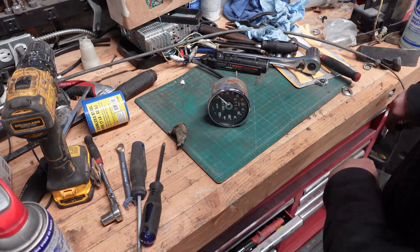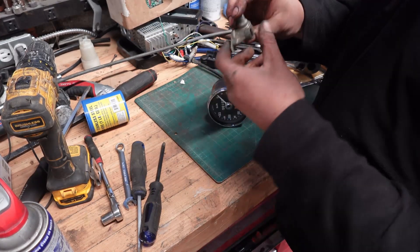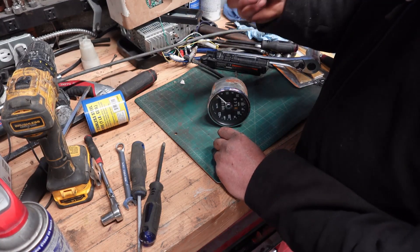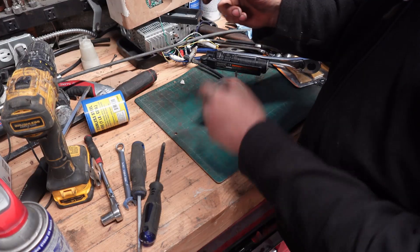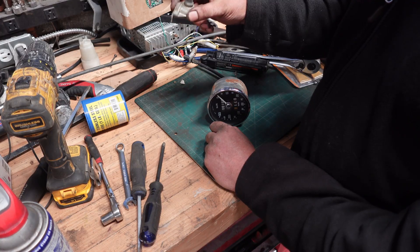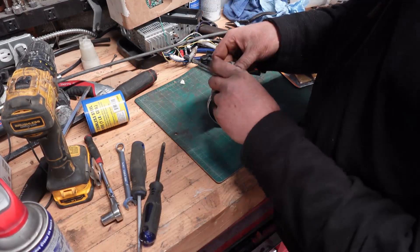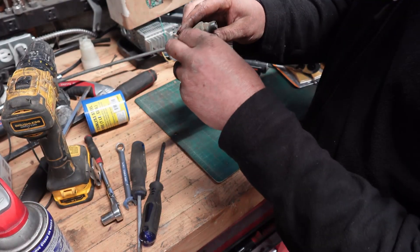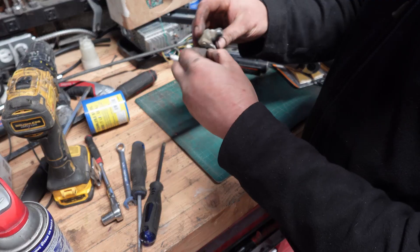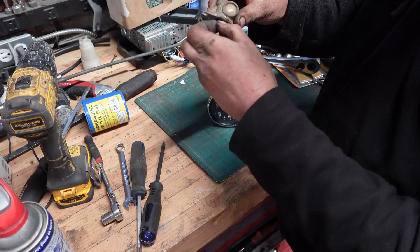So I'm now very suspicious of the angle drive on the gearbox. What probably happened is this gauge-side angle drive got gummed up. I was going at a high rate of speed — this broke when I was going at least 70, maybe 80 — and that angle drive was offering a little too much resistance. The angle drive on the gearbox just couldn't handle that and probably broke. There's basically just a little piece of speedometer cable that lives in there, and they have a tendency to fray and break.